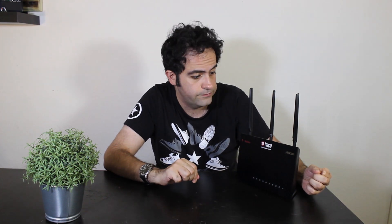Today I want to use my ASUS wireless router as a repeater, which is a range extender. Many wireless routers don't have this option, and to use them as a repeater you'd have to install third-party firmware such as DD-WRT. But not with this one — it has ASUS WRT firmware, which is very capable and allows it to be used not only as a wireless router but also as a repeater and many other things as well.